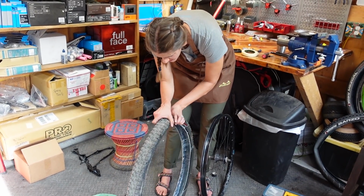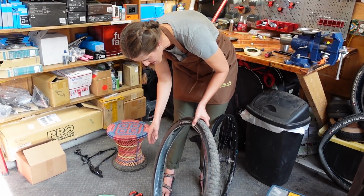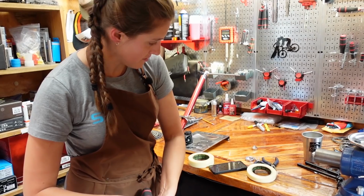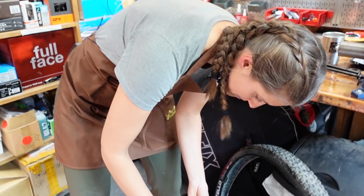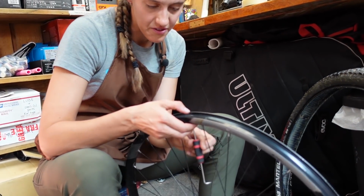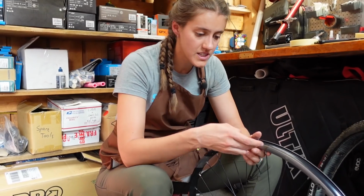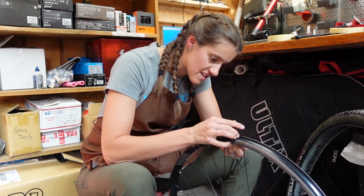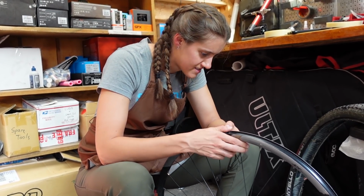Mackie can always tell by looking at the tread. I always think I can tell, and then like 50% of the time I'm wrong, so I've learned to look for the arrow. We've missed a step. Do you know what it is? Putting the valve core back in. Valve stem, yeah. We learned to do this from the bottom, time that I poked the hole in the wrong place. We also learned to get our fingers out of the way. I feel like I've definitely done that before where you put the tire all the way on out the valve stem. Then you're like, cool, there's no way to put air in this.